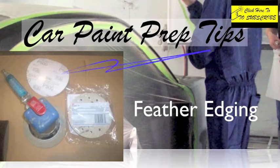That way it's going to be a smooth transition from your bare metal to the top of your clear coat. If you don't get that smooth and feather edge that out, you're probably going to be able to see that after it's painted. You're going to look at it at an angle and see a little wave there, or a ring. That's due to not proper feather edging.